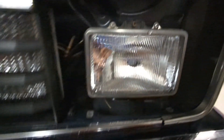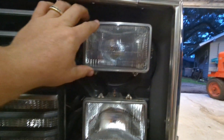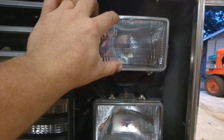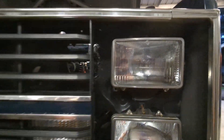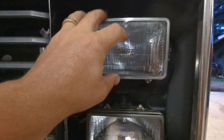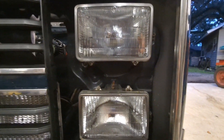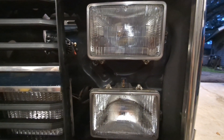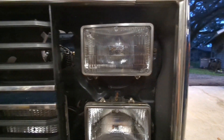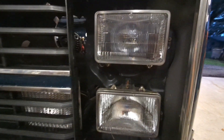So we've got the bezel out of the way with those four screws — and these are the low beams on the top actually. Now we can pull these four Phillips head screws, which is going to take this stainless bezel slash retaining ring off the headlight. In theory we shouldn't even have to readjust them, but I'm going to do these one at a time. I'll change the driver's side first so I can make sure the new bulb is lined up with the other one, since they're already set at a pretty nice height. That way I've got a standard to go off of on the passenger side.